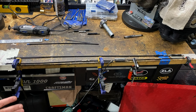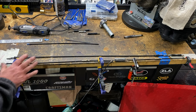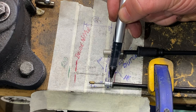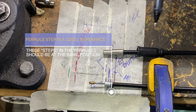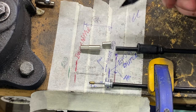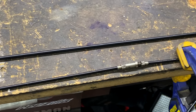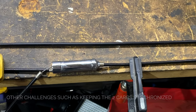There's a lot to be said for ready-made cables, but where's the fun in that? For the outer cable, these steps are the most important. At one end the cable lengths are different, but the most important measurement is this lip or step — that's where it goes into the carburetor, and similarly at the other end. If you take that off and then take the end of the cable off, you need to take this and this into account so that this step here is the same length as this step here. I'm very happy with the look of the cable overall. It's a lot neater — you don't have to deal with that adjuster or the splitter.